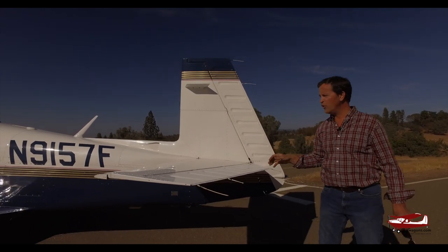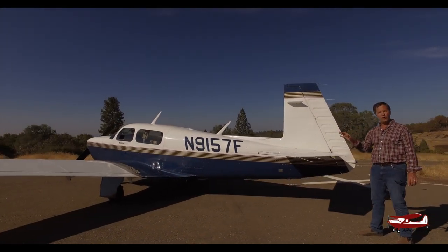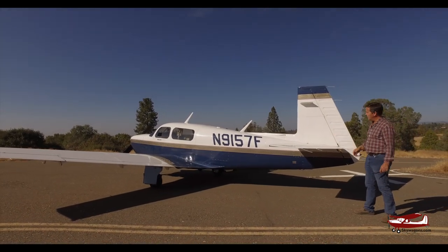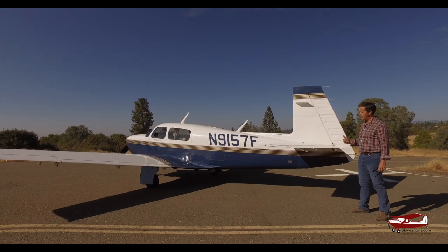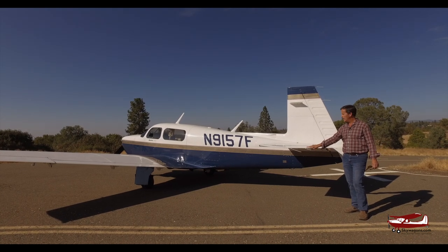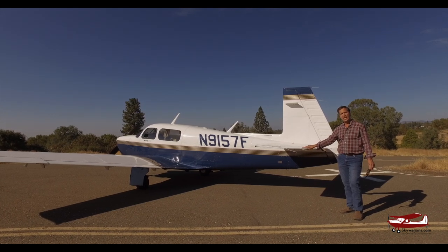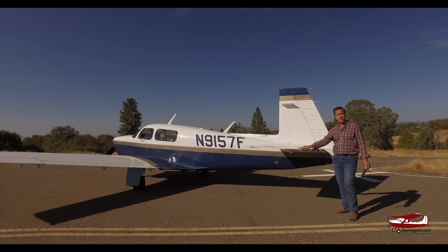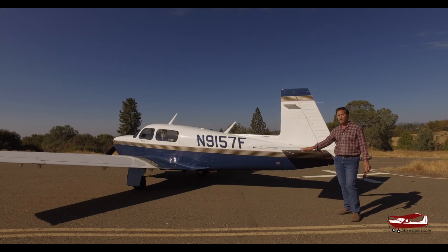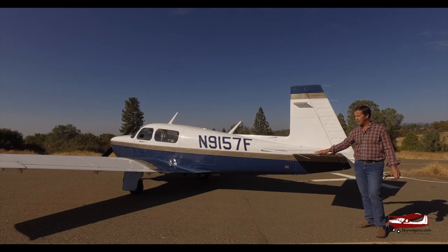The J is actually a very good combination of the modern airframe but with the oldest, simple, efficient technology of the F. It's just a 200 horsepower fuel-injected Lycoming IO-360. It's the mid-length fuselage. They burn about nine gallons an hour, they do about 150 to 160 knots, and they carry a 1,000 to 1,100 pound useful load with 65 gallons of gas. So you're not running a giant gas-sucking 550 or 540 Lycoming and no turbocharging — it's a very simple, basic, efficient plane that's incredibly well-designed and efficient on fuel.